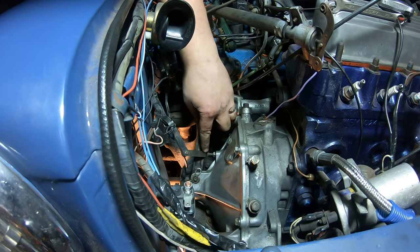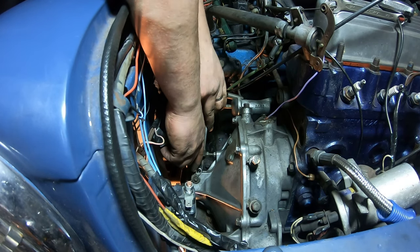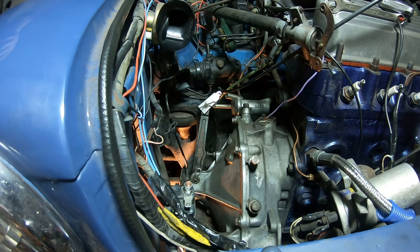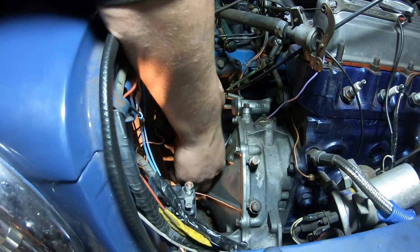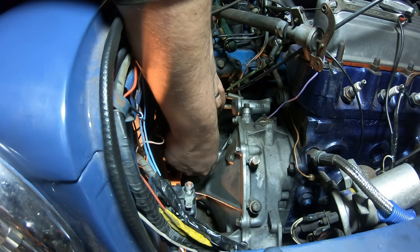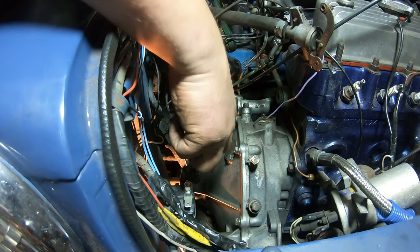And you can see that I've got my feeler gauge in between the arm and the adjuster here. And if I just pull it out, it should hopefully fall a little bit. I just want to be able to slip it in there nice and freely without any resistance. Well, like slight resistance, top and bottom. Once you're happy, rotate that adjusting nut. And then nip up the locking nut.